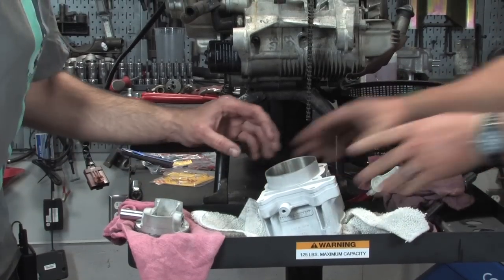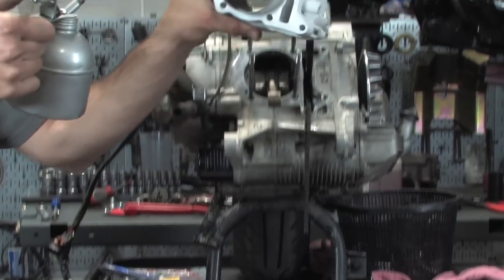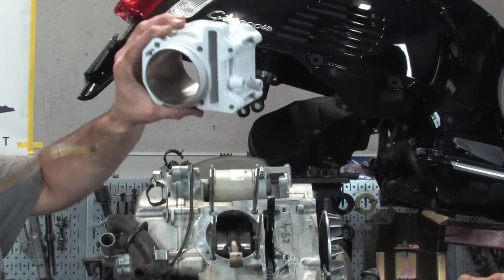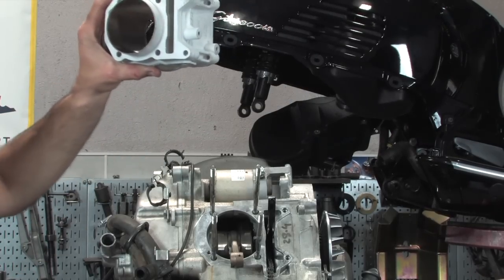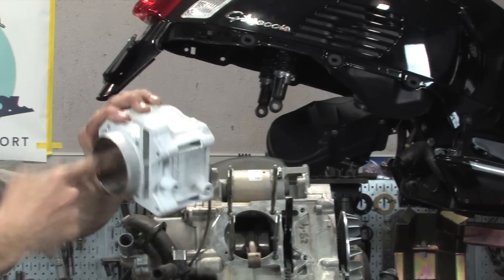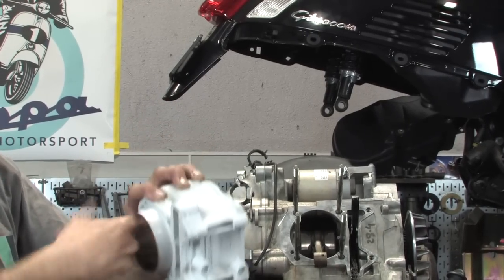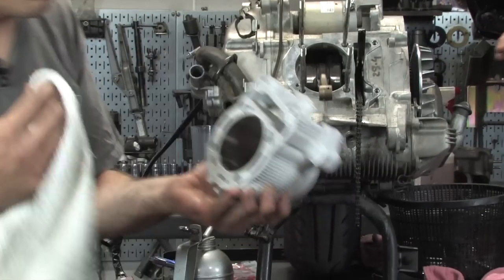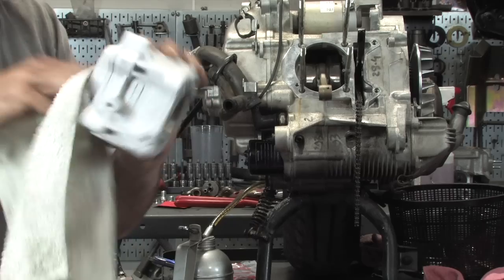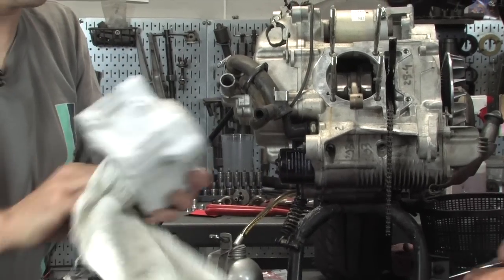And you want to oil the cylinder, and I'll show you how much oil you want to put on it. See that? Some people sit there and squirt tons of oil. Now all you need is a drip. Like, I put two drips in there. And then you just work that one little drip everywhere in there. Oil the whole thing with that one drip, on both sides. And whatever residue is left, you wipe it all out. That's all the oil you need for a cylinder.